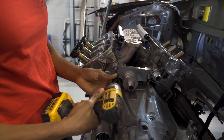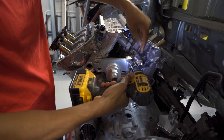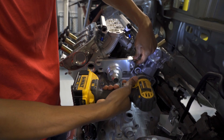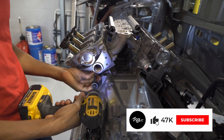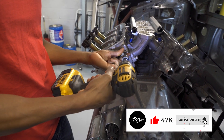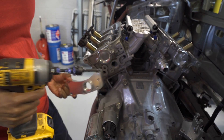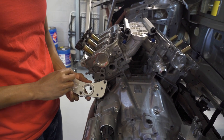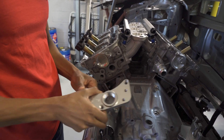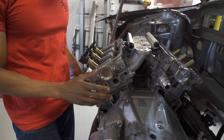I'm going to convert this from a front wheel drive water neck to a rear wheel drive in just a couple of seconds. I'll start by removing the center section and the head flange. Typically you want to make sure you have your gaskets and everything installed just like you would with the stock water neck — I don't have any of that on here right now as we're just doing everything for fitment purposes, since this car is being fabricated and we're building a header and all sorts of other stuff.